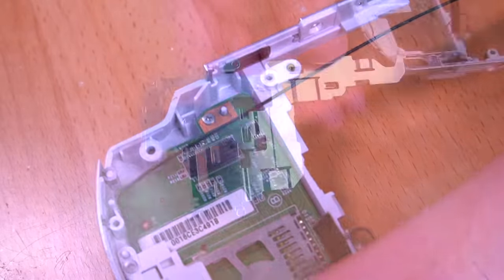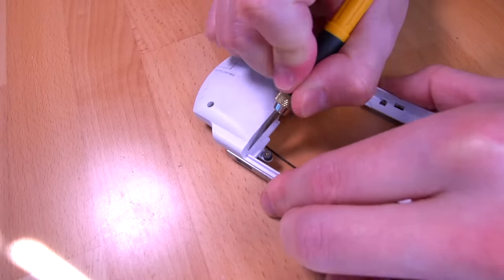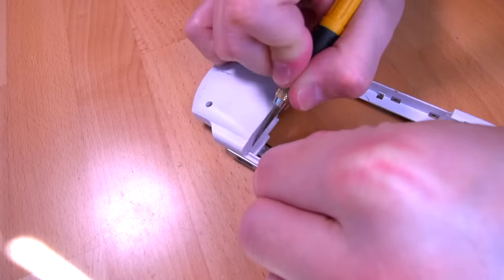Now we need to trim this plastic piece. My preferred way of doing this is to score the plastic using a sharp blade like a craft knife, and then with a set of needle nose pliers carefully fatigue the plastic off by bending it back and forth along the score until it eventually breaks off — this usually results in a nice clean break. Next we need to trim the small plastic fins on the other side of the UMD drive opening; flush cutters work really well for this. If you have some rough edges you can use a file to smooth it out.